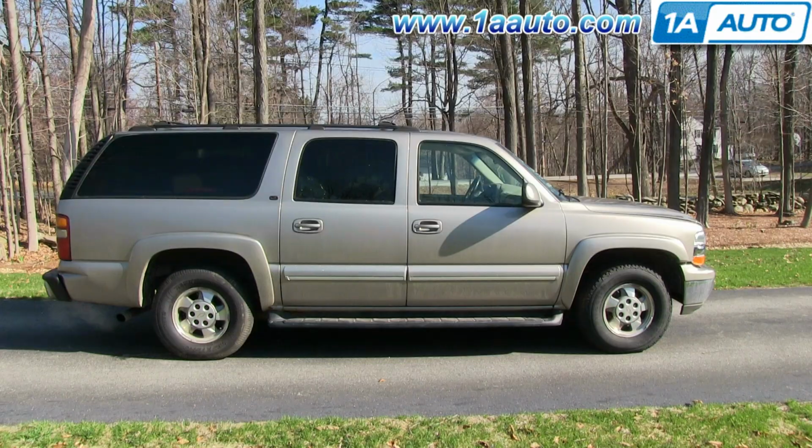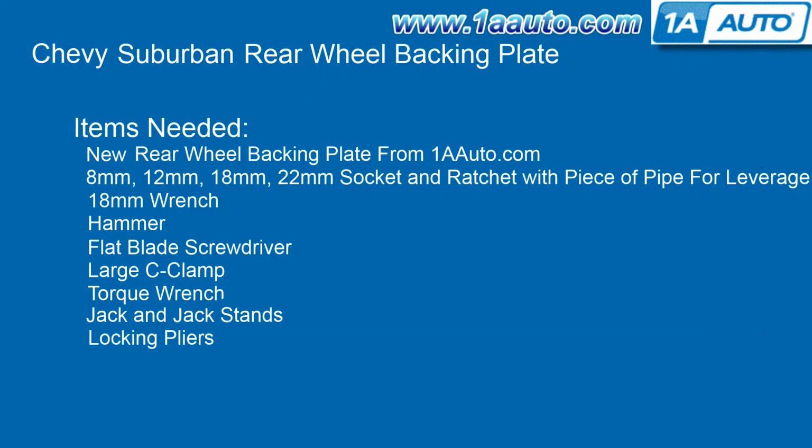Thanks. In this video, we're going to show you how to replace the rear wheel backing plate on this 2002 Chevy Suburban. We show you on the passenger side, but it's the same procedure on the driver's side. The items you'll need are a new rear wheel backing plate from 1AAuto.com, an 8, 12, 18, and 22 millimeter socket and ratchet with a piece of pipe for leverage, an 18 millimeter wrench, a hammer, a flat blade screwdriver, a large C-clamp, a torque wrench, jack and jack stands, and locking pliers.